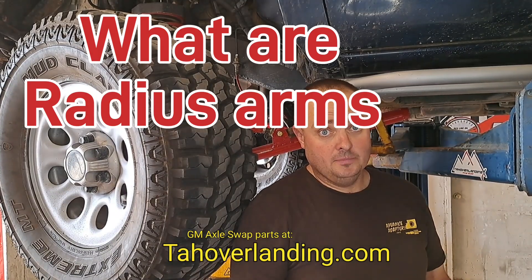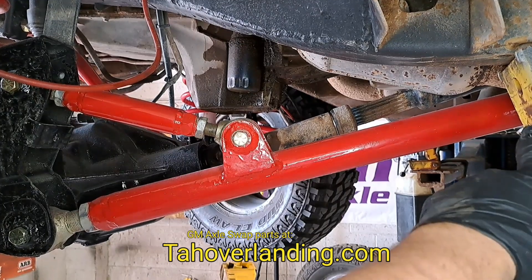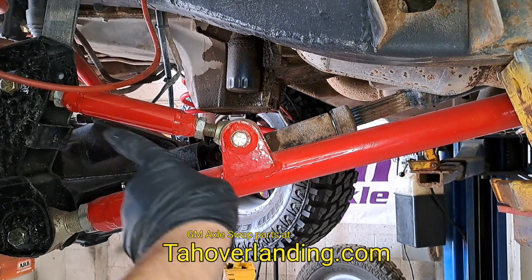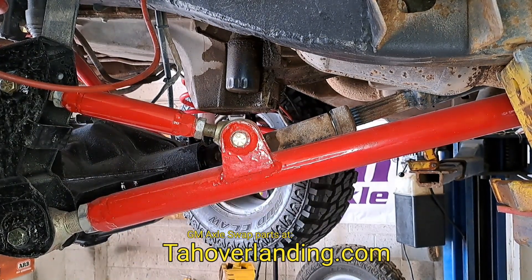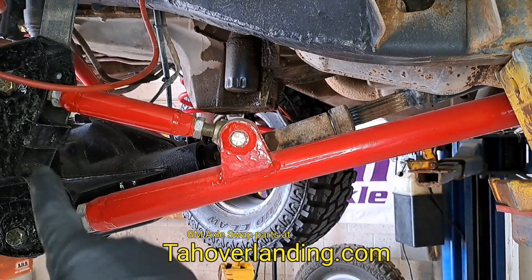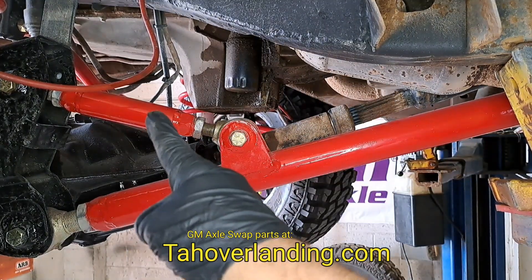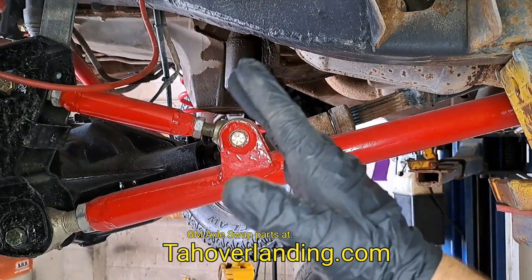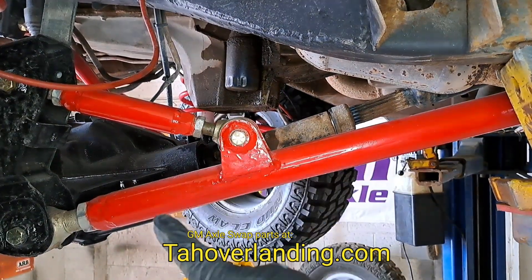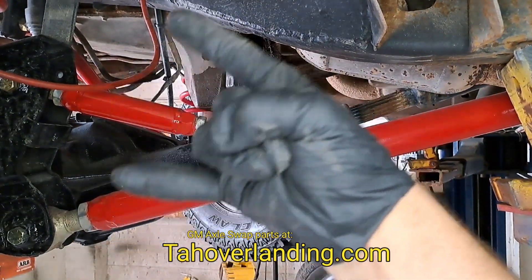So what is a radius arm? This here is one way of doing it — a lower control arm with an upper locating arm tied back to the lower control arm. That's what makes this a radius arm. A radius arm is any arm where the axle cannot pivot away from that arm. It's any length that bolts to the frame at one end with one point, and is bolted to the axle at the other end with at least two points.